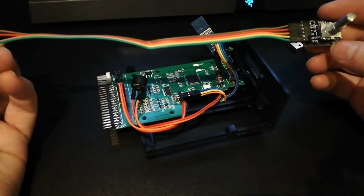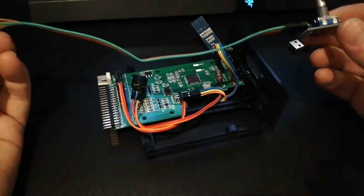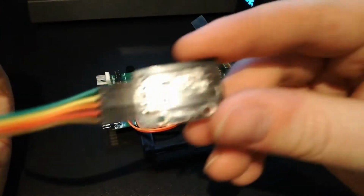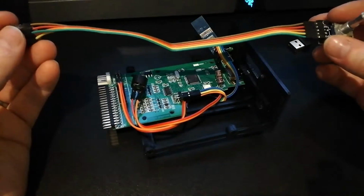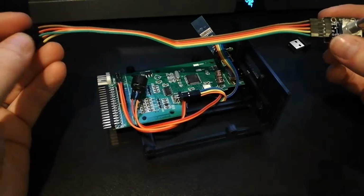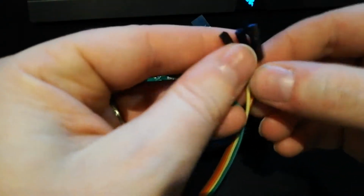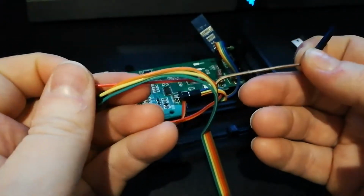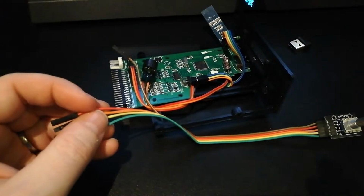So connection to +3 only needed if encoder has pull-up resistors. So on the back, I've got pull-up resistors. You can see that. So it needs the 3-volt connection, which is the orange, I would imagine, on my screen, which would be the yellow. So let me split those a bit more. Okay, and then very gingerly I will try to plug these in.